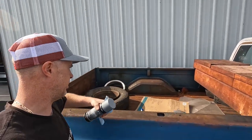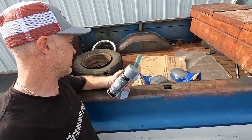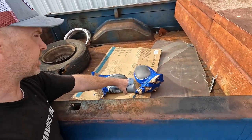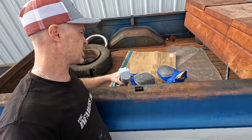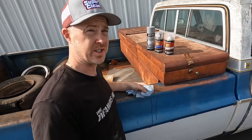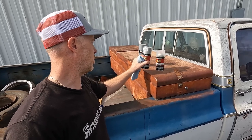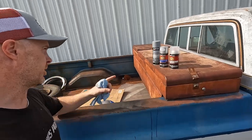It's a little windy today, so I've created this cocoon of a spray booth in the back of the old square body for the side mirrors. I've masked them up, sanded them down, and feathered out all the stone chips — there were quite a few in the black mirror. The DSG one was pretty clean. I sanded everything down with 320 grit sandpaper and got everything nice and smooth. Going to use some filler primer using the whole Duplicolor line — not sponsored, not endorsed — it's just what's available at O'Reilly's, AutoZone, or Advanced Auto. Got the silver YN Duplicolor match paint and some clear coat.